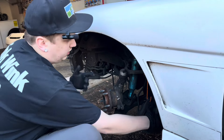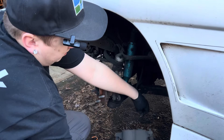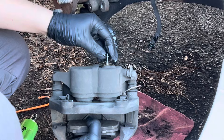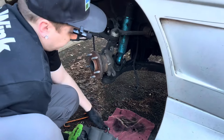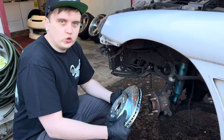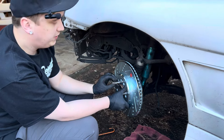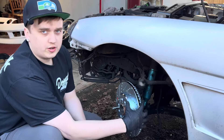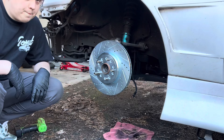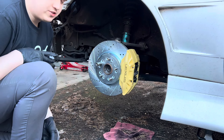I like to take the banjo bolt — see that 14mm — and I always take both old washers and just put them back in the caliper with the banjo bolt, then let that hang for a little bit. I'm going to have to bleed it no matter what. Now it is time for the new brake rotor — put a lug nut on to hold it in place. Next, I'm just going to grab the brake caliper and put it on here. The brake caliper is already assembled with the pads and hardware in there. Now they're all installed and it's pretty much time to bleed.